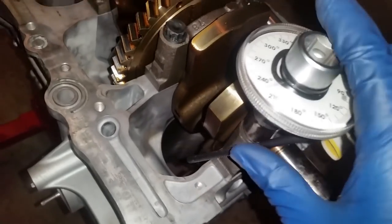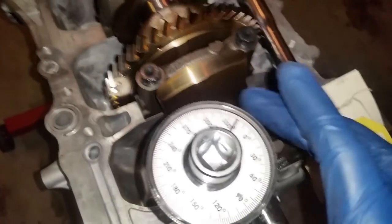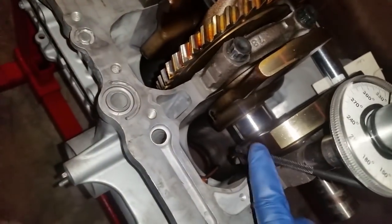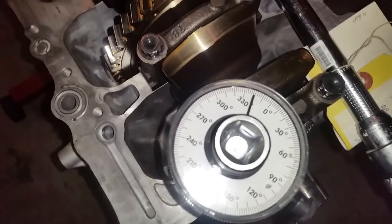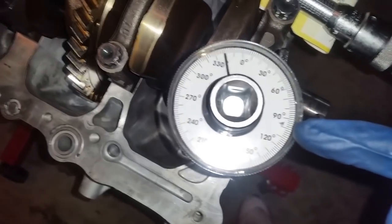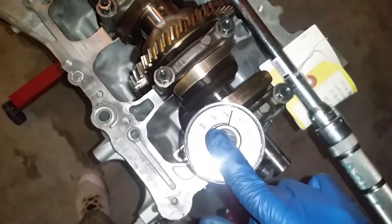Fit in, I would find a good locking spot right here. And then once I continue to follow, it will go from 0 to 90. This is obviously adjustable. I haven't adjusted it yet, but whenever you find that locking point right here, so the wheel doesn't turn, you would turn the face or target of it to where it would fall into zero. That way, when you continue on, you would reach your 90 degrees. So you do your first pass of 30 foot-pounds and then your 90 degrees all the way